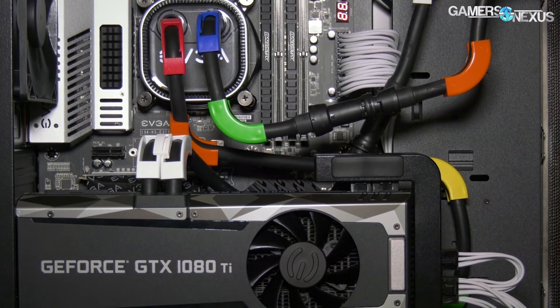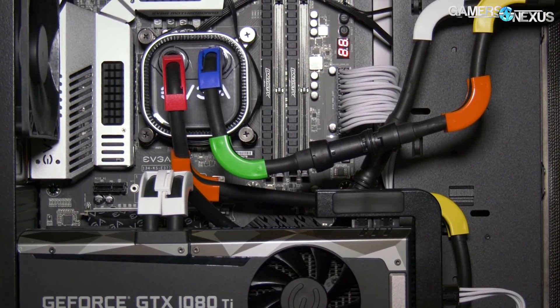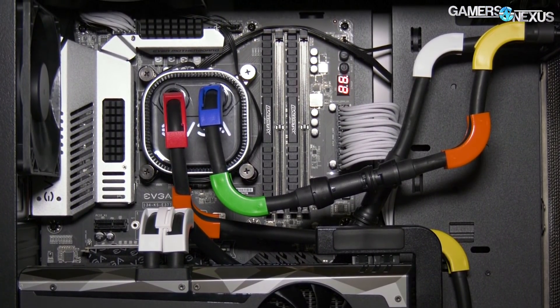So let's start with the core component stuff. For the QRG, this is basically the hybrid pump that we've seen in the past. I believe the CPU version is gen 5; this might still be gen 4.5. Either way, it's two pumps — so if you buy one for the GPU and one for the CPU, they will each have their own pump, which means you won't have issues with liquid running too slowly. For example, in some 420mm radiators on the market the pumps are kind of anemic, ending up with slow enough liquid movement that they perform worse, especially when you start daisy-chaining things off of them.